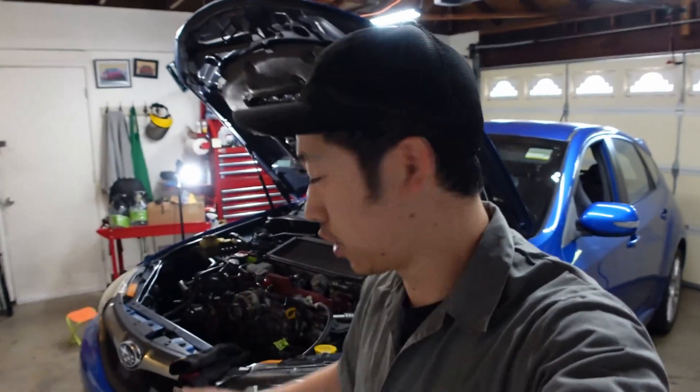So we've done all we could on this side without having to lift the engine, but the space is way too tight on the driver's side and I need a little bit more leverage. We're going to try to lift the engine just a little bit to get more clearance, which is going to involve loosening the nuts for the engine mounts on the bottom of the car, as well as loosening up the pitch mount. So let's get to it.